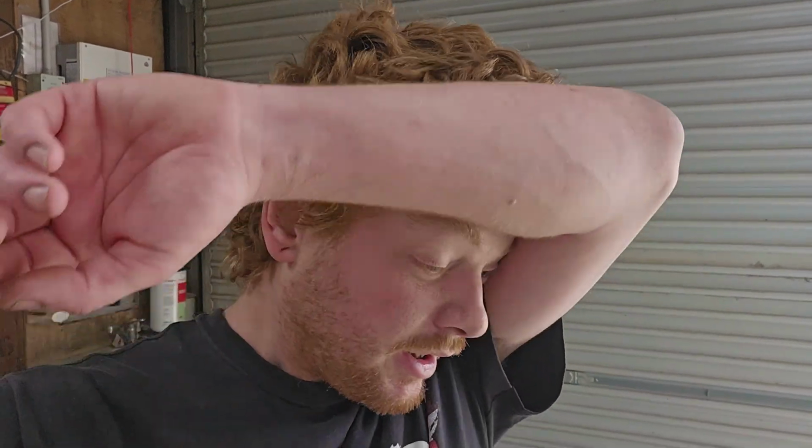I just held it on the trans brake a little bit, no two-step on it. The converter's pretty loose, I was going to like 4.5, 5-ish, so that helps it spool up, obviously. I did hear the gate open, so I know there's a 3-pound spring. I took a quick datalog. I'm just going to go have some lunch and look over it on a laptop and check over everything.